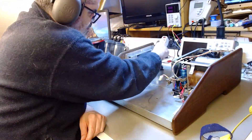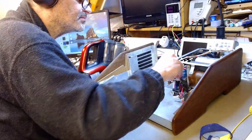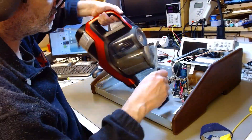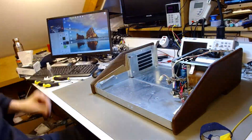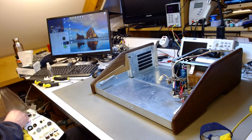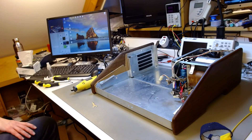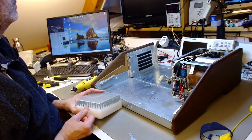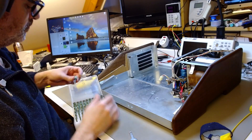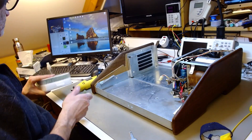The first order of the day when I freed up the motherboard was to clean the base of the case. It was full of dust, full of grime, and I had to vacuum it first so I could see the spots where there was corrosion. Aluminum doesn't corrode easily but it can corrode, and there were several corrosion spots which I'm going to remove using my Dremel and a very hard rubber head. Those green heads that you're seeing are not sanding heads.